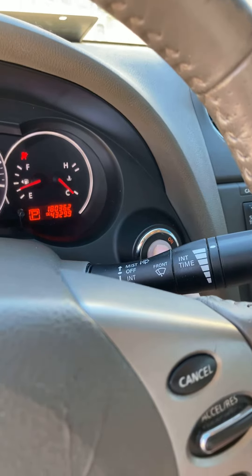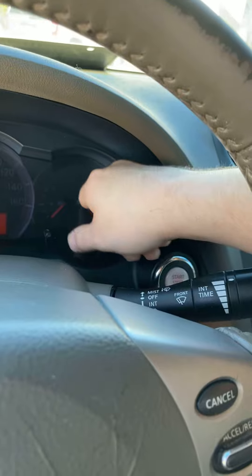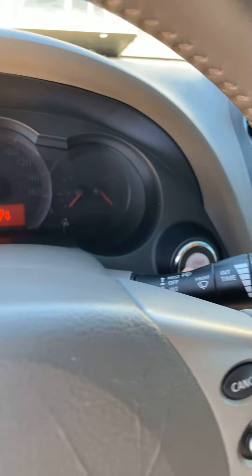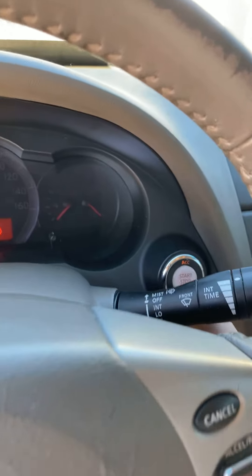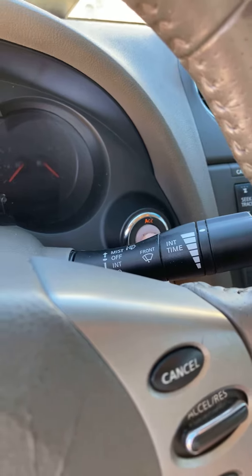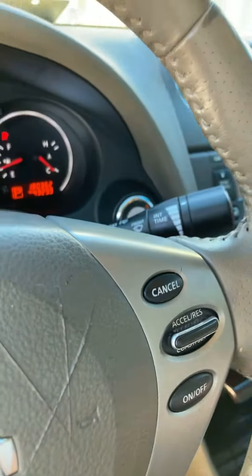After the second time, turn it off and wait for it to flash five times. The second flash is just closing out the programming. Then when you hit it for the third time and turn it back on, it'll go straight to ACC first — that's how you know it's programmed, plus you have the security light.